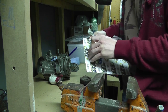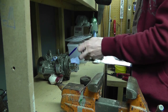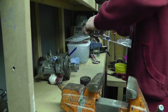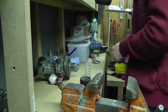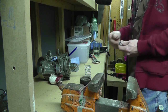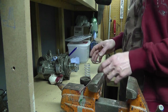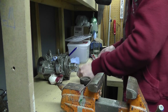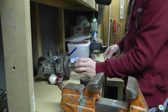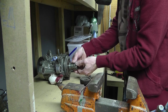And again, I told you on my last video that the spring and the rollers actually are what determines the output. So it changes — the spring on the back side of the pulley where the gearbox is at, and the other portion, the rollers and the centrifugal force changes, and you can tune.